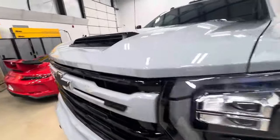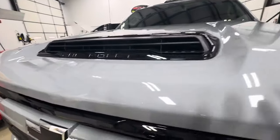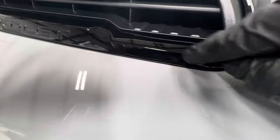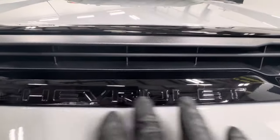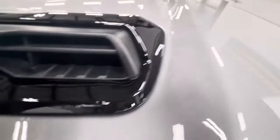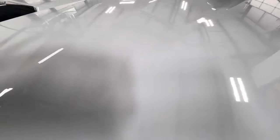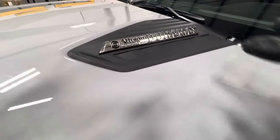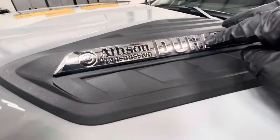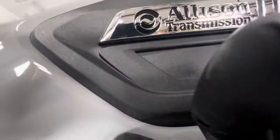On this hood, much like the GMC hoods with these vents, we remove these so we don't have any lines back in here — no lines anywhere. All this gets covered up front, but we don't want any lines. All our corners get capped off, all our edges get wrapped. These pieces are just clips and one 8-millimeter screw, so there's no lines anywhere around it.